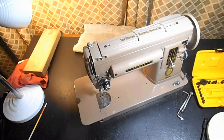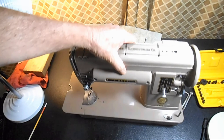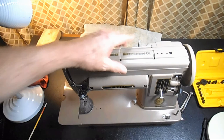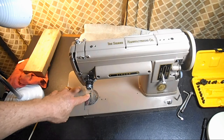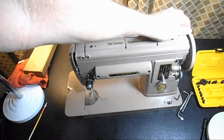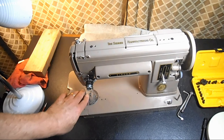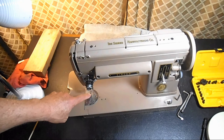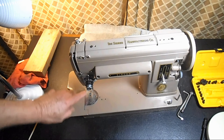This is Andy Tube. In this video I'm going to be working on the feed dog of a Singer model 301A. This is my guinea pig for this series — I named this machine 'Oh No', as in 'oh no, what's wrong with my feed dog?' I want to check the height and position of the feed dog. When I turn the hand wheel and it goes down and then comes up, at the highest point, is it the correct height? Singer says it should be 0.043 inches above the needle plate.